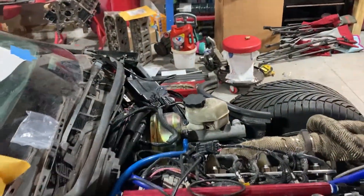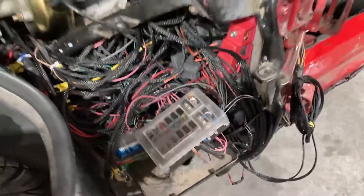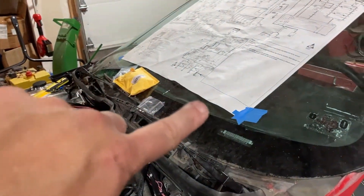There's the passenger side O2 sensor - I got that in and it's just laying up here. I'm going to wire up the Spartan 2 wideband controller and the PCM. I'm going to open it up, put that in there, wire in the pigtail, then go towards the EGR sensor and log it with HP Tuners.